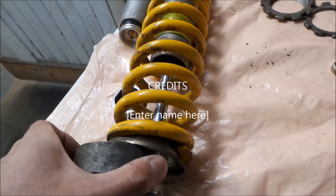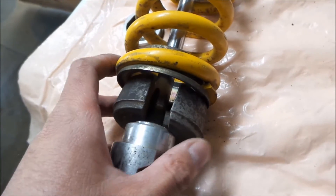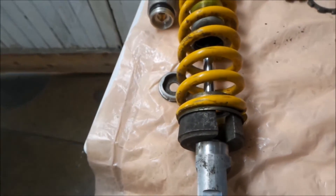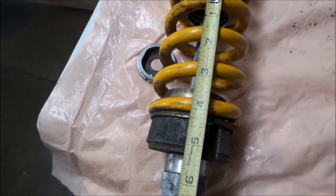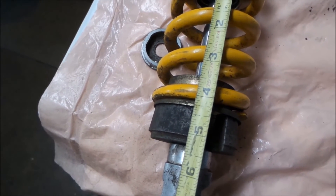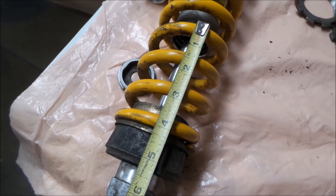I'm going to flip the shock collar around to the lowered setting. You can see it now rests on the bottom of the collar instead of in the middle. I pushed the shaft up all the way. Let's go measure it — from here to here. Yeah, you can see that our travel has changed. Now it is about four and a quarter inches. So we lost more than an inch — wait, it was five and a half before, so we've lost about one and a quarter inches of travel by doing that.